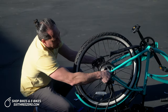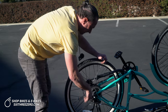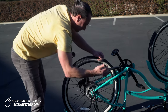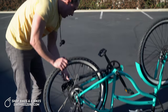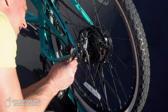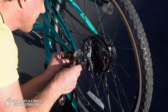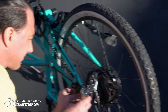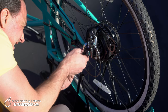You can also test it when you flip the bike back up. Give it a little spin — make sure it's running free in the caliper and that the derailleur looks correct. Then go ahead and tighten the axle nuts down, making sure the axle is all the way down at the bottom of the dropout. Tighten the axle nuts — I'll use my ratchet. Then this side had the derailleur guard, so I'm going to slip that back on.